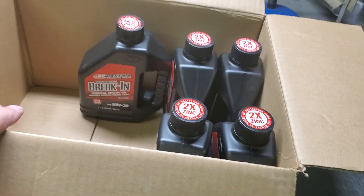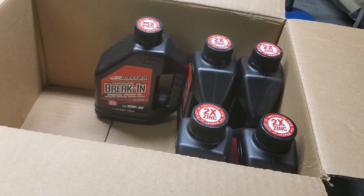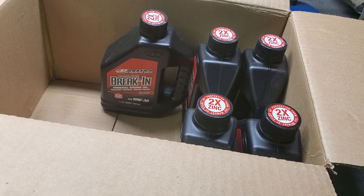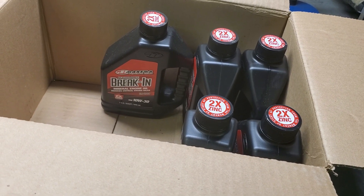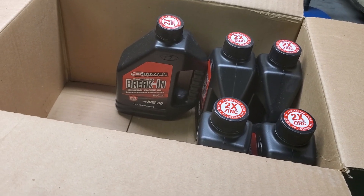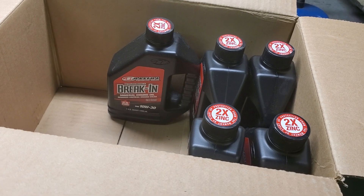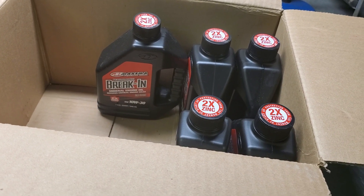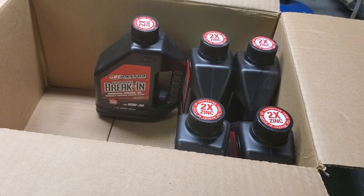The critical break-in on your engine is the cylinders and the rings. So I like to say run this for 30 minutes or an hour, get everything all happy and broken in, spin the filter off, and add another quart of oil, top it off and keep it in there.